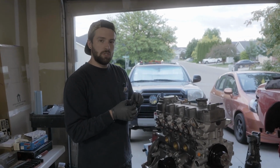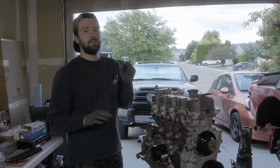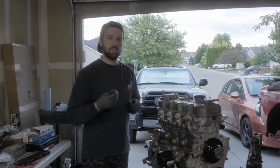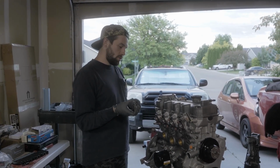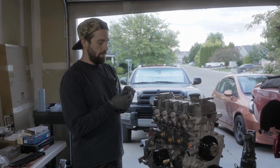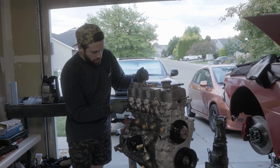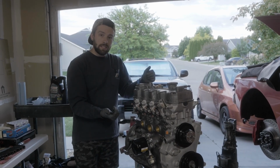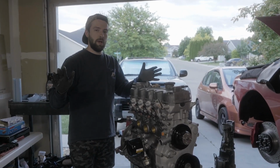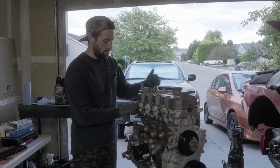Exhaust studs aren't actually torqued down to crazy amounts of foot-pounds. So what I do is use the lower ratings. Say it's 20 to 25 foot-pounds, I'll use 20 when I use anti-seize, because it's a lubricant and it's going to help really torque it down, and you can get a false reading. So if you're at 20, it's most likely higher than that. But I learned a lesson on a Volvo I owned: if you're not using anti-seize, it's a lot cheaper to be pulling these threads out than to have it seize inside the cylinder head, where you have to either drill and cut. It's a pain in the absolute butt. So I'd much rather these things back out and deal with that problem than having to go back in and drill the sucker out.